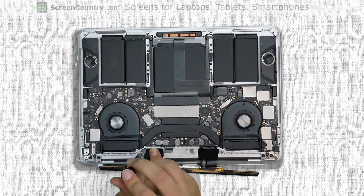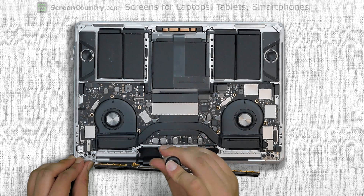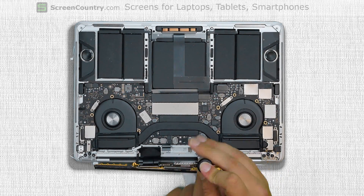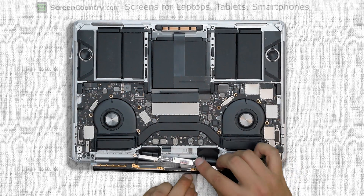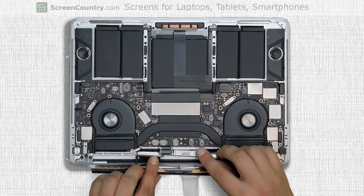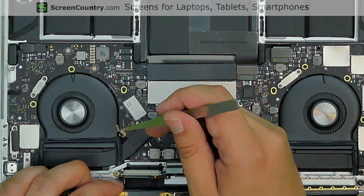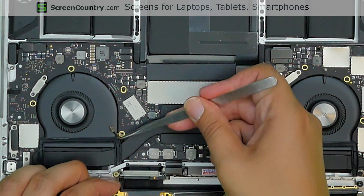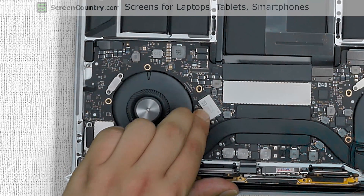Using a Torx 3 screwdriver, secure two screws on the left black plastic cable tensioner. Secure the right black plastic cable tensioner with two more screws. Bend the LCD driver board back in place and slide the WiFi antenna assembly behind it while guiding the coaxial antenna cables with tweezers. Carefully snap in the three coaxial antenna connectors one by one.